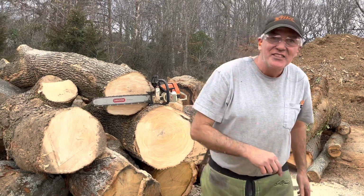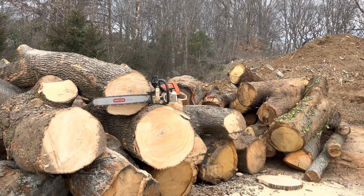Missed it by that much. Anyway, I think she runs pretty dang good for a little 60cc saw. Chain's nice and hungry. That's my Hexa home ground that's on there. And it's making it work for it. I got the rakers under 25. And anyway, Justin should be pretty happy with that. She goes now.